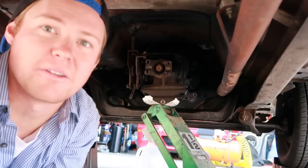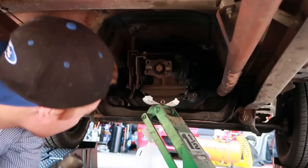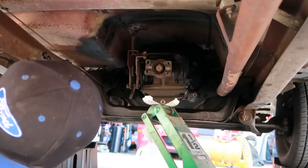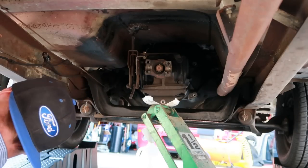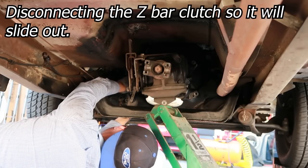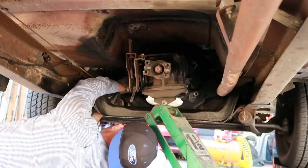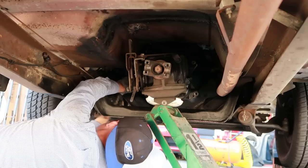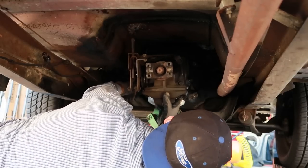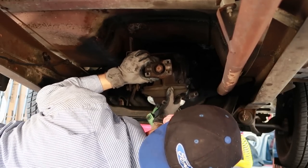We will get this thing out. I want to make sure you guys can see it so I'm just going to leave the frame right here. This is the most fun part of the whole thing — I'll just adjust the clutch rod, get some slack that way and it'll come out. There it goes — see it? Popped off. Okay, so we are free.